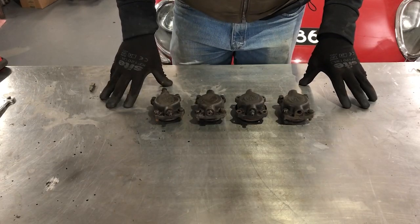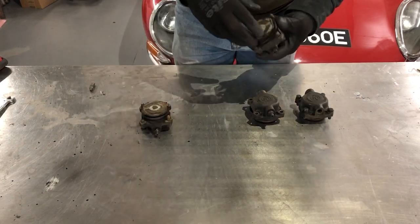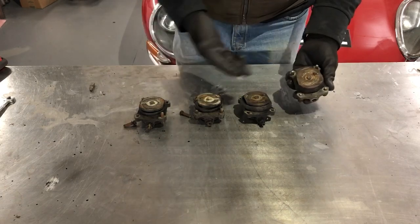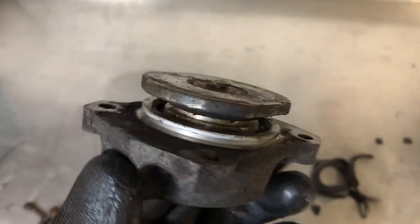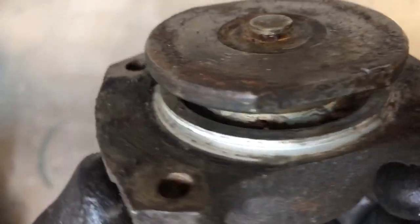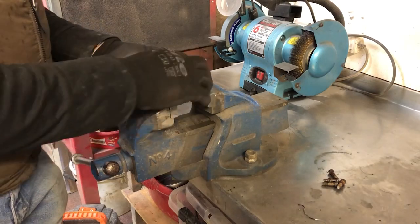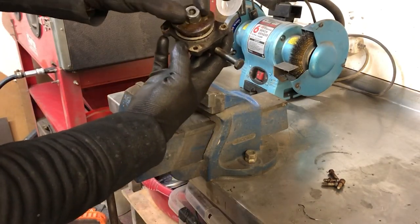Another little set of parts that need some attention are these brake pistons. On the outside they all look in relatively good and clean condition, but I need to get the pistons out and see what the bores of these pistons actually look like. I'll take them and get a bit of compressed air in which will force the piston out so I can inspect it more closely. If these are in good condition I'll be able to get them replated, clean them up, and reuse them with new seals. I've tried taking this piston out and it simply won't do it — I block up one end and use an airline to try and force the piston out, but as you can see in there, there's a lot of corrosion. So with penetrating fluid in here and soaking in, I'm putting it in the vise to push the piston back in and try and work it a little bit — if I can get it to the stage where I can actually rotate the piston within the piston carrier, then I'll be doing well.